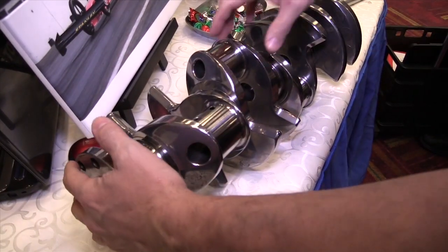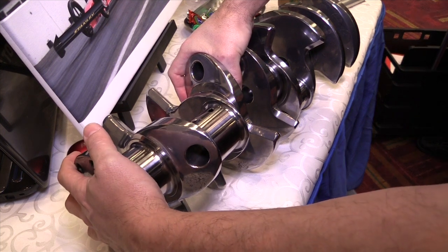This system could become a supplement to the traditional dyno — essentially a mobile dyno. The dyno is still an important tool for development and in-lab testing; however, oftentimes you need to know what happens in the vehicle itself. Real data taken in the vehicle can be brought back into a dyno environment and used to do a better job of tuning to a particular road condition. The real advantage is capturing very high frequency signatures. A dyno has a lot of mass inertia, which means high frequency signals are typically dampened by the time you measure torque on the engine output. With this system, you put it right in the shaft and measure much higher frequency signatures and vibrations that you won't necessarily pick up on a dyno load cell.